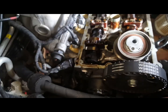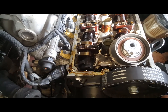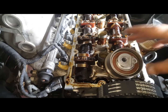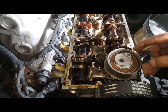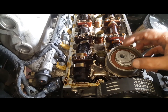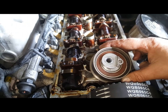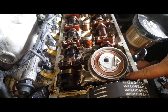When you do it that way, this arm stays all the way over here — it doesn't come over to where it should be. The correct way to install it: I found this out because I had to come back and readjust. Old mate said just put the tensioner pulley back on how it came off, and basically when it's in there this arm will be wherever it is — it was pointing down, not to the right.